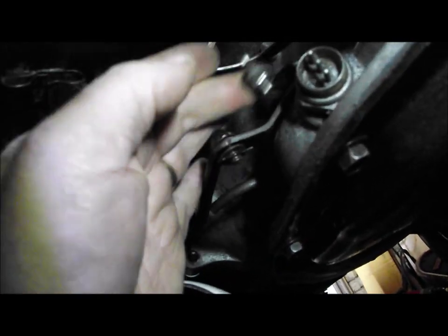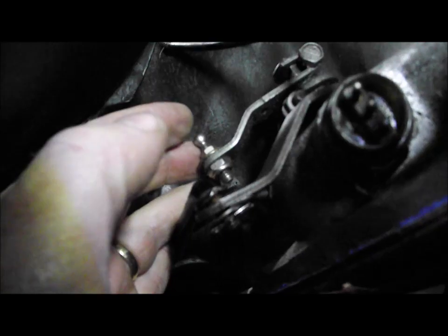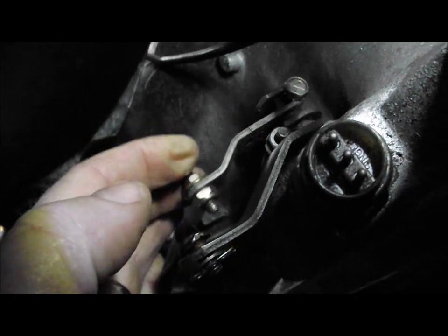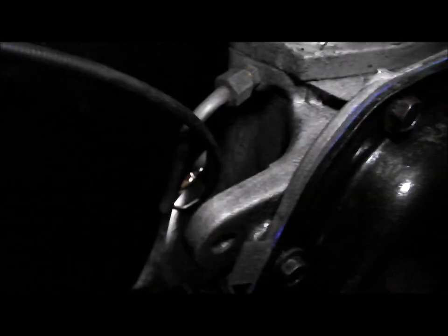You see down here, this is the other end of the lever. So this is the lever here. Which obviously decides that must be closed, and then the lever pulled backwards to there, so that'll be wide open throttle, and that'll be on tick over there. So this cable needs to come back from here and through this bolt on the gearbox here. You can see that's the flange there that will go onto that. So I've just got to do a bit of rerouting of the accelerator cable, sorry, the throttle cable onto there, get that round to there. And that also reminds me, I've got to put the hose on there for the oil cooler.